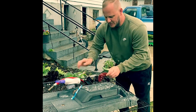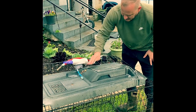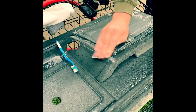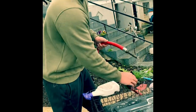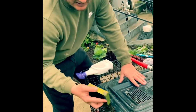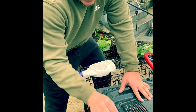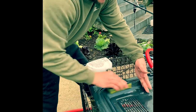Get our sandpaper wet and just wet sand it, kind of like you do a car. You can see these pieces flake up. I'm pinching the hose to smooth it out so it won't come out no more. I switched from the dish pad paper to the sponge and this is 400 grit, because I'm not trying to remove a bunch of it — just trying to knock down some of the high sides and give the new paint something to adhere to.